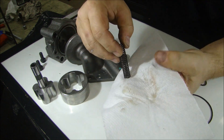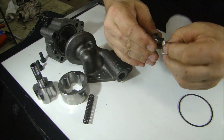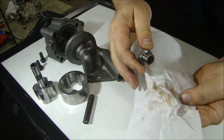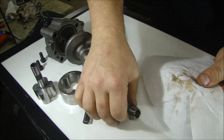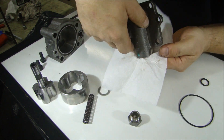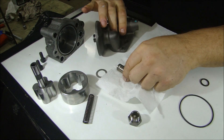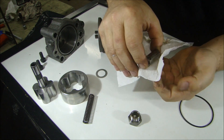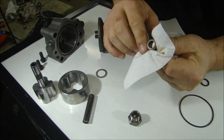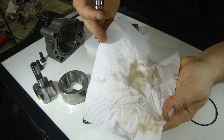It's kind of dirty — see how dirty the oil is. I'll soak that. But let's take a look inside this plug. Rust — rust inside the plug. And let's drain some of this oil out. There's our poppet in there, and you can see there's rust on it. It's rusty. So there's rust just from inside the check valve.